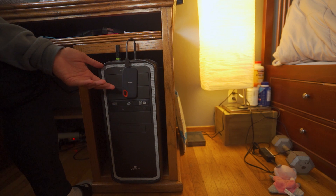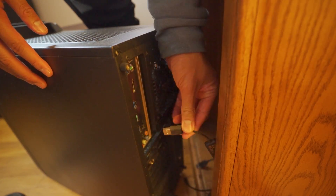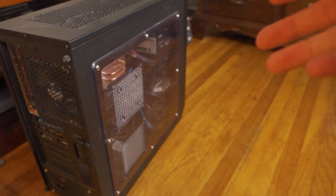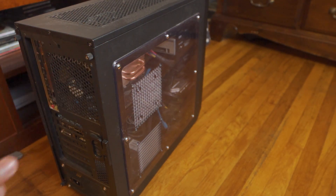For the next steps, you need to unplug everything and make sure the power is off. Pull the power cable out. Now that my PC is unplugged, I'm going to remove the side cover. Most towers are going to have a side cover like this — you unscrew it on the side and it should slide off.